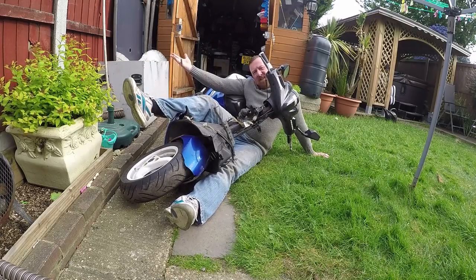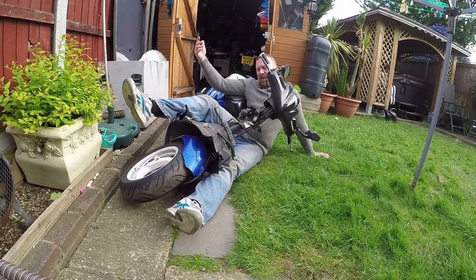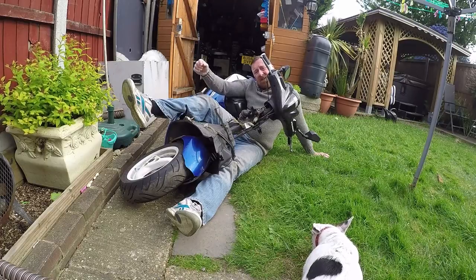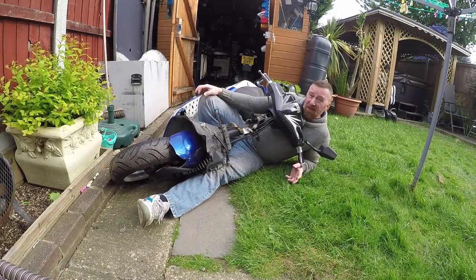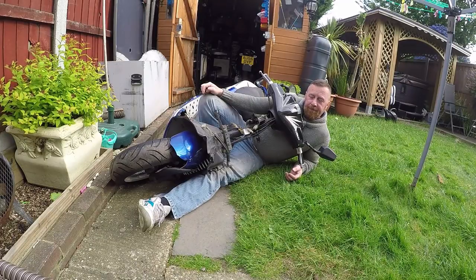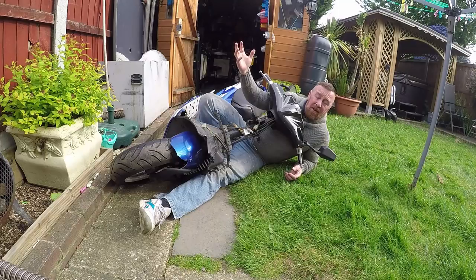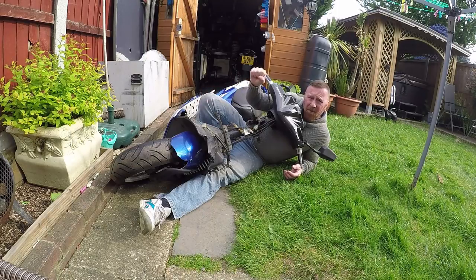What's the next thing? If you watch my recent video - this can happen to anybody - at some stage in your bike career you're gonna fall off your bike. Don't just think you're gonna pick it back up again and ride down the road. I did it on my last video - you can see at the seafront I left the lock on, ended up on the floor, so it can happen to anybody. This is where you damage the panels. Firstly, pick yourself up, get the bike up, move it off the road onto the path if you can, put it on the stand and leave it. When the bike's been on its side, the carburettor will generally drain all the petrol out.